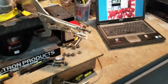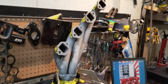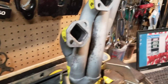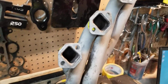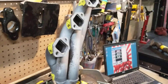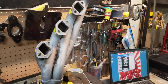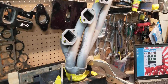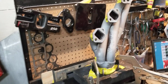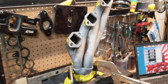Surprisingly, that's very low — very low for an aftermarket header. These tubes appear to flow; they look like they should flow. A lot of misinformed individuals may assume that they flow well. Some people may say all you have to do is just work the collector. No — that will get you a little bit more flow, but it's a lot more involved than just working the collector. And if you work the collector with no way of testing your efforts, you don't know what you're getting. You may get an extra 20 CFM or just an extra 2 CFM.